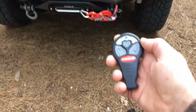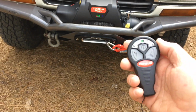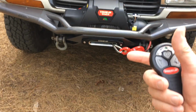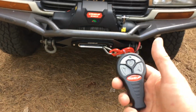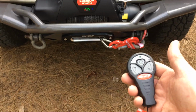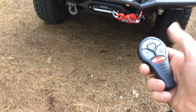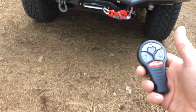It makes sense. You got to be careful when you're coiling it in, because the mechanics of the roller tend to glide. So after you release the button, it has a lot of momentum and torque, so it's still rolling in. So you always want to stop before you want the thing to really stop. So you got to stop early, let go of the button, because it'll just keep coasting in, and you'll end up breaking something if you're not careful. And same thing when it's going out. When it's going out, it coasts. The motor will keep turning after you release the button. It doesn't just start and stop instantaneously.